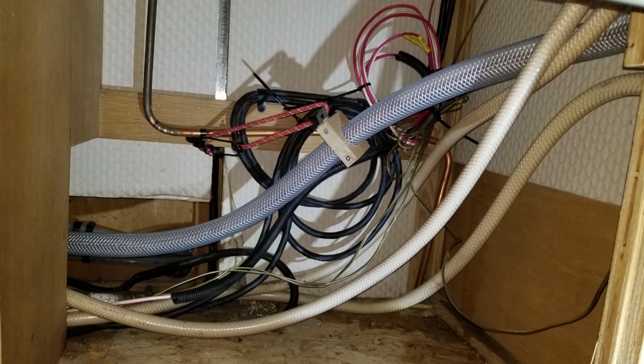That keeps it from bending or kinking and so forth, and it works well. What I would do if I was to do this again, I'll probably do it anyway, is go to a hydraulic place or one of these places that do fittings, and make two right angle sections of swivel hose, with the ABS piping in, just a 15 inch piece of hose instead of this thing. But it works and there's no problem with it.